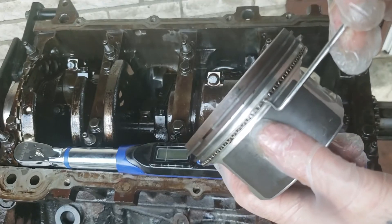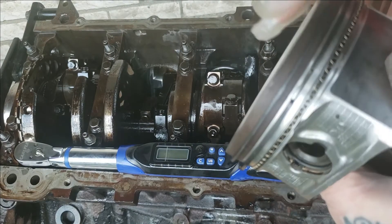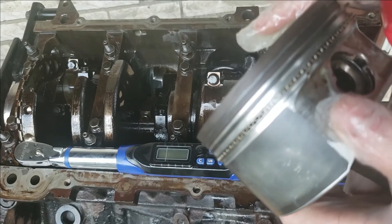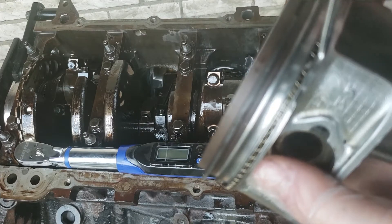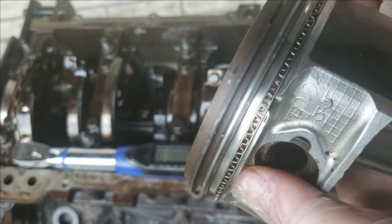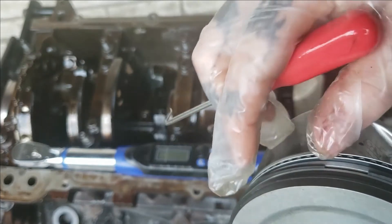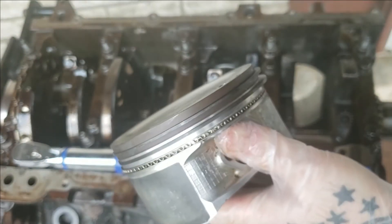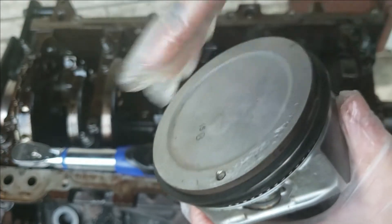The gap is here. Now you see this little center gold ring — these need to go up. There's a connecting point and that connecting point needs the tabs up on it. It shouldn't hurt if you install it backwards, but per instructions, that little tab right here needs to be up. I like to keep that tab over here. My compression ring I always turn here, and I leave this ring on the back. No compression rings are straight down — they're opposite from one another. Always oil your rings up good for install.